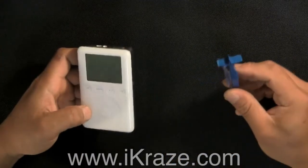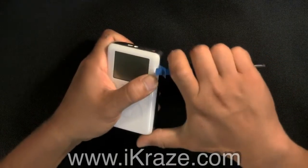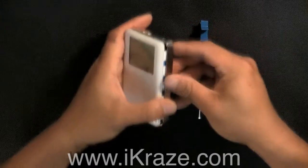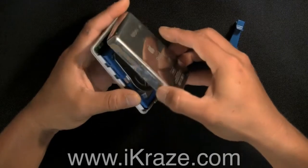Then place the eye tool in the seam of the two halves and apply medium pressure. You may need to go back and forth until it opens, pressing firmly in and down to release the clips. Slowly open up the iPod and place both halves face down. Do not open it too far apart — there's a ribbon cable still connected.